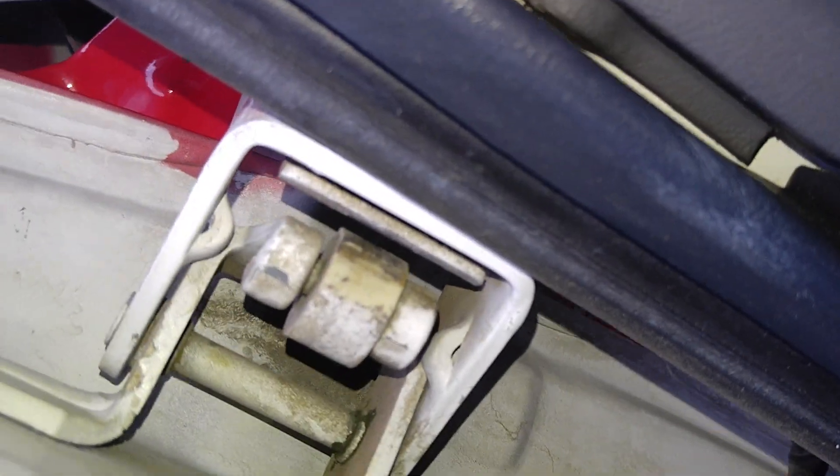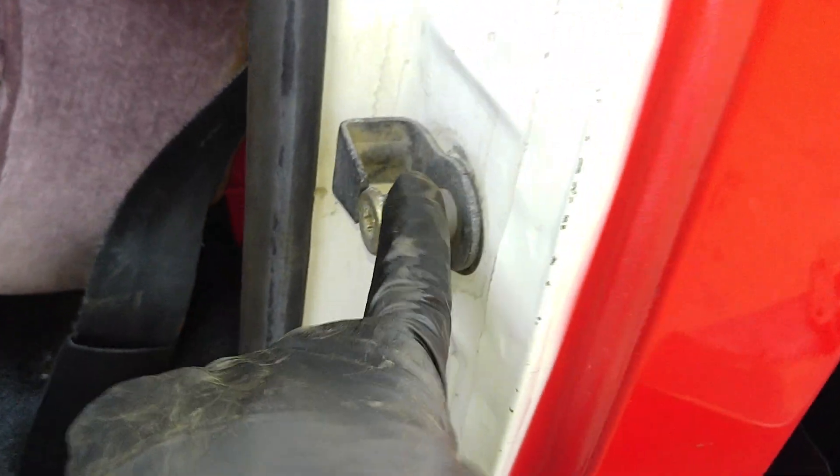What I did do was I fixed the door hinge. The door was sagging for some reason — the hinge pins are in really good shape considering they were never lubed. All I did was loosen the three bolts, two from through the fender and one from through here, and then I adjusted the striker ever so slightly. Now the door lines up perfectly.